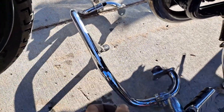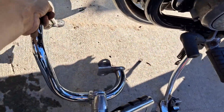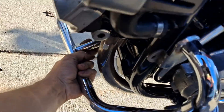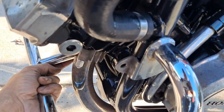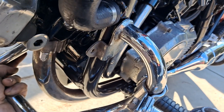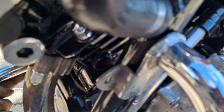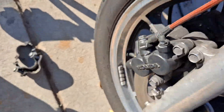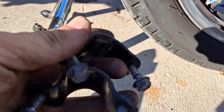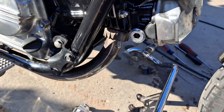These fit in quite simply, and these are the better crash guards to have. These Honda ones are pretty nice — they don't look great, but they do look good and they function quite well. This is how they kind of look once they're installed. You can see that it just bolts on like so in these three locations: here on the subframe of the bike, down here also part of the subframe — the lower horizontal rail. It's just a number of three clamps to bolt in — just these. There's a little one for the lower, it goes right there. And then there's these two larger ones which are offset, and they go on the two ends like so. It installs quite easily.